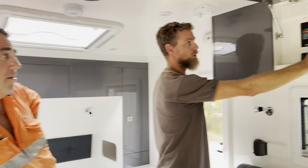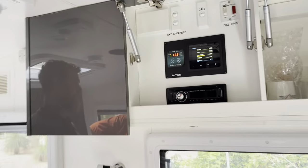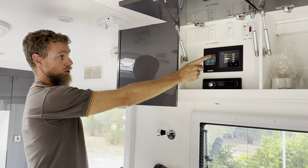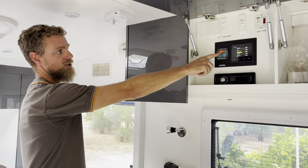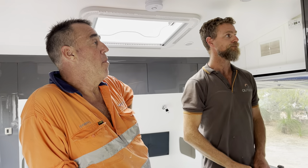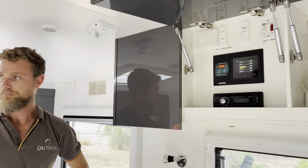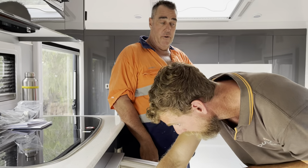As you can see, we're sucking 46 amps out of the battery at the moment, and we're only putting in seven - but it's a pretty cloudy day out there. That'll continue to go up. On the inverter control you can actually do a power consumption reading - if you click the select button on the main page it rolls through to power. So 0.65 kilowatts - 650 watts is what the air conditioner's running at the moment, sucking about 50 amps out of the battery. We haven't got the fridge going at the moment. To put a kettle on or a microwave, we'd add to that again.